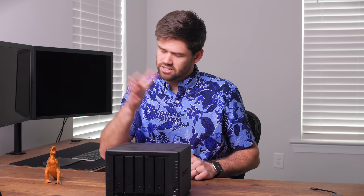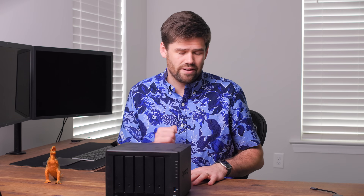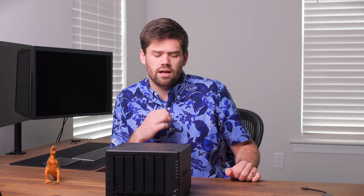The 10 gig upgrade is very expensive and might not be necessary. If you're not wired, skip it — you're not going to be saturating a one gig connection in any real use case over Wi-Fi. And if you're just not copying massive files — maybe you just use your NAS for photos — then it might not be worth it. If you've never sat there waiting for a copy to finish and thought 'this is slow,' you may honestly not notice the upgrade.